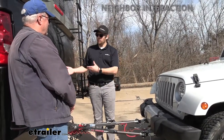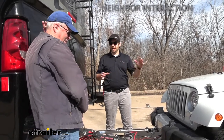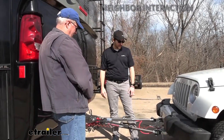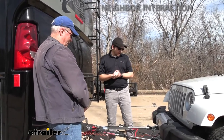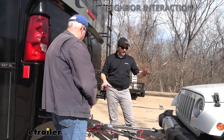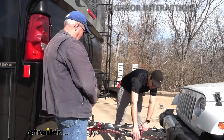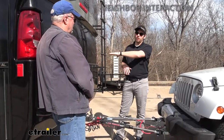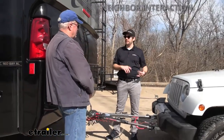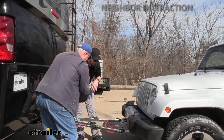The concept of flat towing is pretty simple — we're keeping it flat and towing it. We're eliminating the chucking you might see from dollies because we're keeping it level. The arms lock themselves in, and the car will easily follow right behind your motorhome. It tracks really nicely behind the motorhome, making it a lot easier to drive — especially pulling into recreational areas. These tow bar arms lock in place but do have a little bit of movement. This is a non-binding tow bar, so instead of having to push a button on the side to release a binding tow bar, you just pull the lever back and it pops free, making it much easier to get undone.